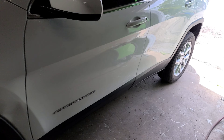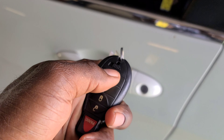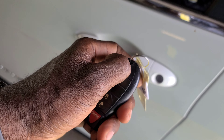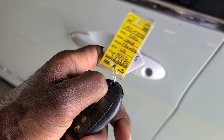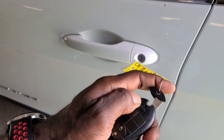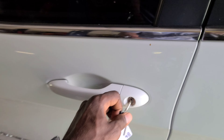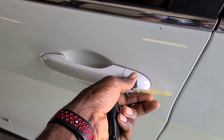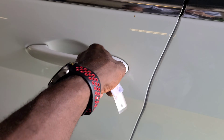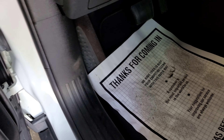So you come up to your car, try to unlock the door, the remote is dead — you'll come right here with your key. Pull this to release the blade, push your blade in here, and you turn it — this will get the car to unlock.